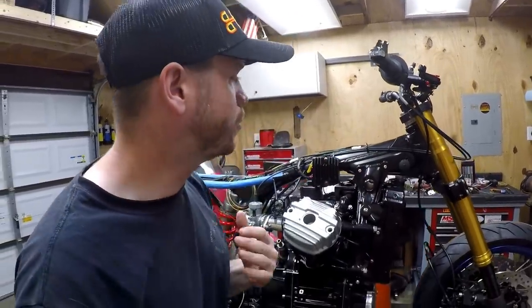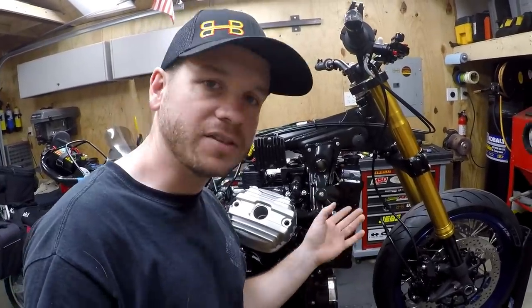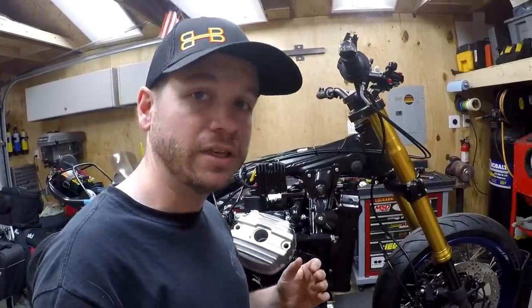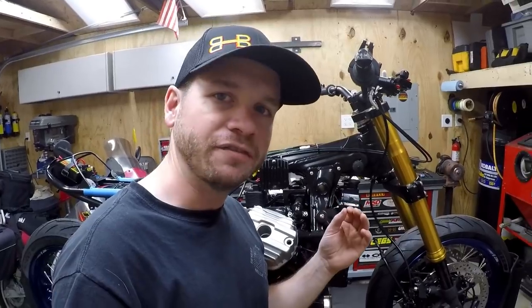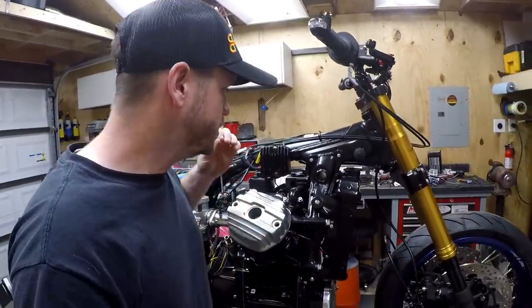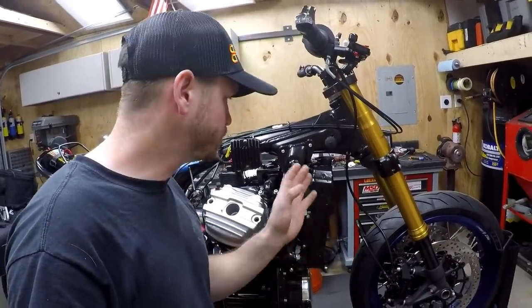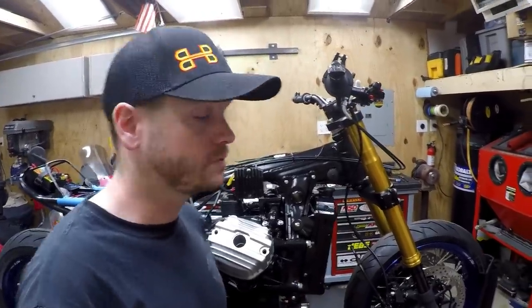So I felt more comfortable in having it fully disassembled, meaning they desolder the sides and the core and clean all those individual tubes out manually and strip everything down. I had a feeling that there could have been the potential for a blocked passage, and that's something that we just don't want. If we're going this far, again, we're going that far. So disassembled and then fully cleaned, reassembled, resoldered, and then freshly painted, and it is literally good as new.